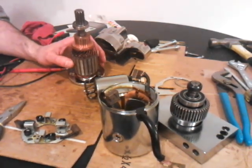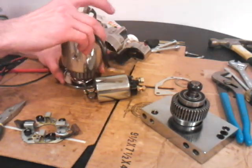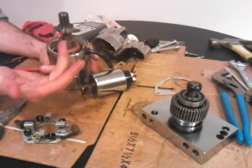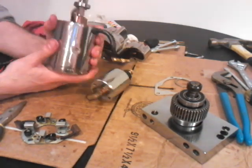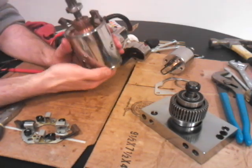You have your armature here and your armature housing. It goes in like that — just slide it over. And make sure the brushes are on top when you put this together. If the brush is on the bottom, no good.